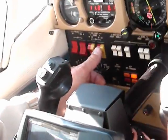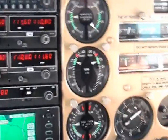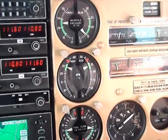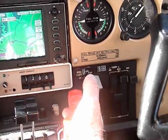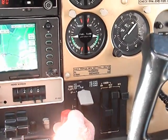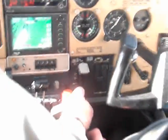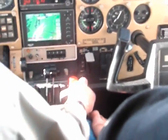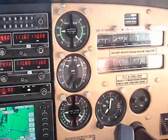The first thing we are doing is putting both boost pumps in to see what effect it has on engine performance. We will notice that the rear engine is running rough. So we pull back on the mixture control to give less fuel flow to the engine to smooth it out, but we have left both pumps running. We managed to get the airplane to fly at normal RPM and everything by doing this.